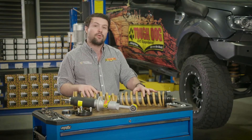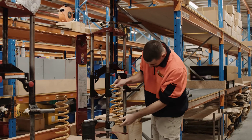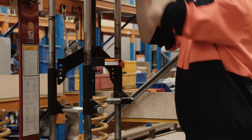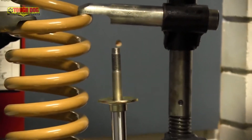The most important tool for strut assembly is a wall or bench mounted spring compressor. The first step is to fit the coil onto the spring compressor and compress the spring so that the shock absorber shaft will be well clear of the top of the coil. Next, grab your washer and fit this to the shock absorber shaft.